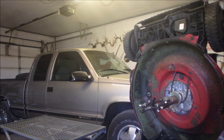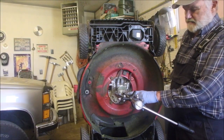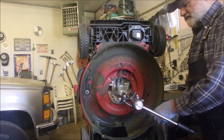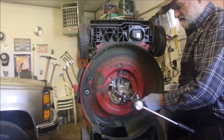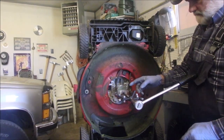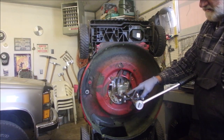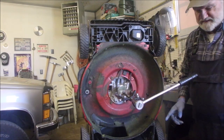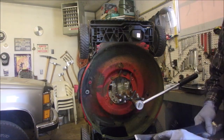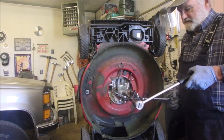Okay, I sharpened the end of my puller and I put a small dent with a quarter-inch drill into this bolt. I'm using this instead of my screwdriver, which is giving the bolt kind of a path to follow. I put a point on the puller, and then I drilled a quarter inch groove into the bolt. Wasn't easy with my drill bit, just not on the drill press. And then I'm using this groove for the bolt to travel in, and we'll see if we got it. And this keeps it from wandering a little bit too, right?